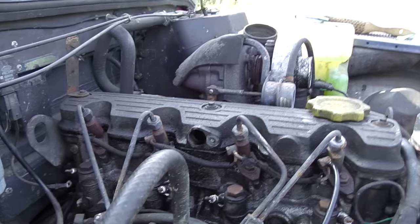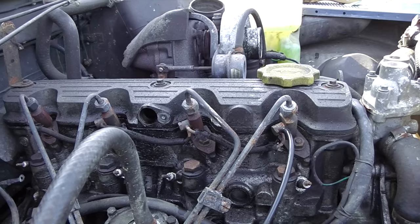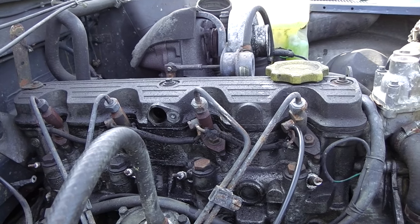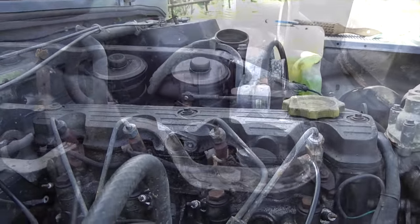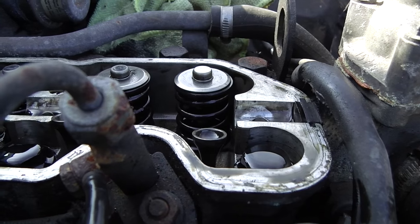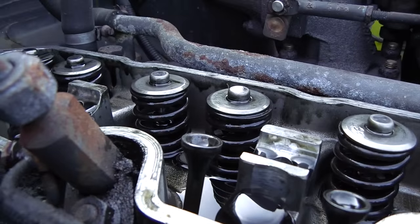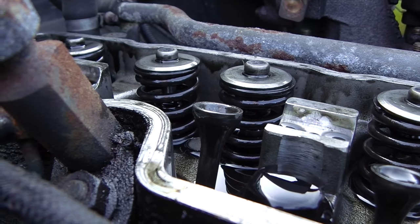So what I'm going to do is whisk the rocker cover off and have a look, and see if the valve stem seals are quite dry and brittle. Sometimes you can take the cover off and find the valve stem seal is halfway up the actual valve itself, so it's not actually doing any function. The rocker arms are all off now, and you can see on the video there are a couple of valve stem seals quite high up on the valve, especially on one cylinder — it's not level with the others.